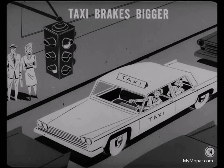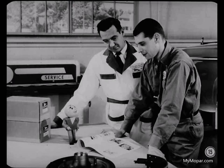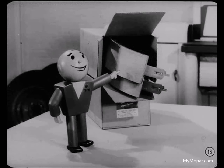The important point to remember is this: use the linings and other brake parts that were designed for the particular brakes you're servicing. This brake application chart shows which linings and other brake parts to use. And speaking of linings, on Imperials, always replace the brake linings with complete new shoe and lining assemblies. If you use relined shoes, you might install the wrong shoes.